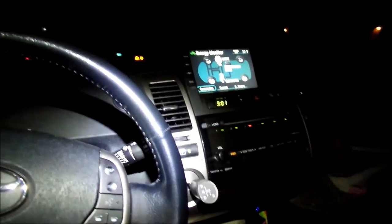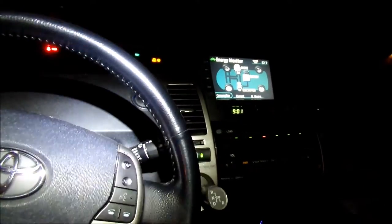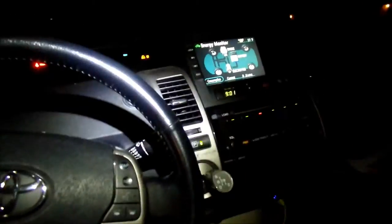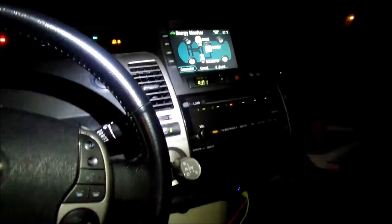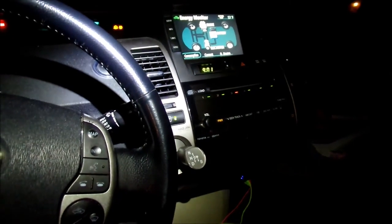It's just tedious. You have to squeeze both of the radiator hoses and prime the pump. If you do that combination and then you let the bleed valve open. I don't know why mine was leaking from the bleed valve, but hopefully it won't be leaking anymore. Actually, I should check it while it's running.